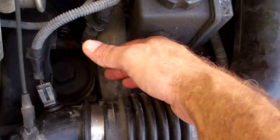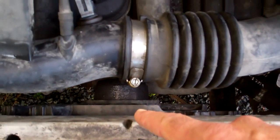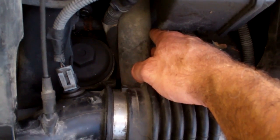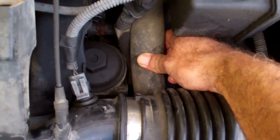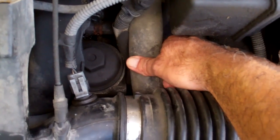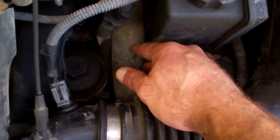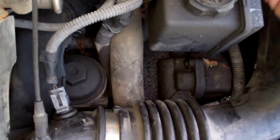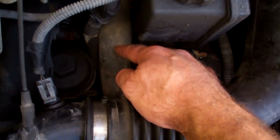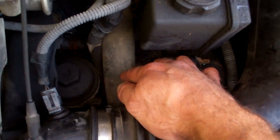In what I'm doing here, I don't have any loose shirts on — anything that could potentially get caught in the fan or any other moving part. Our fan is down in there. This is our radiator hose for the thermostat. Once this vehicle heats up, I can tell by pressing on this hose — there's no real fluid flow through there yet, it's just kind of warm. But if the engine temperature goes way up, this hose should become very hot because the thermostat should kick in and let the water pump move fluid through this engine and to the radiator where it will cool down.